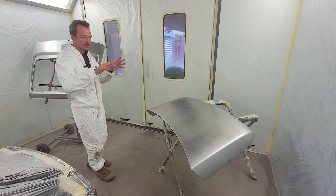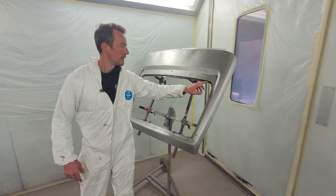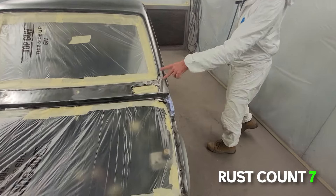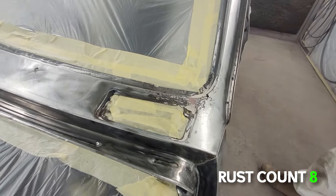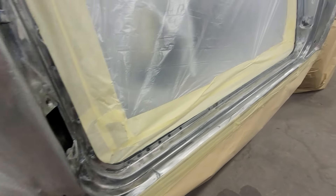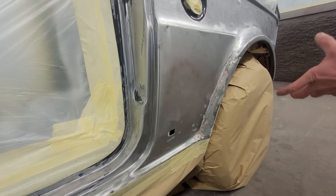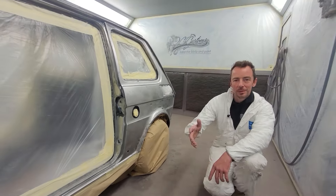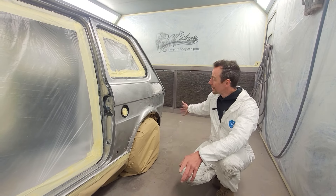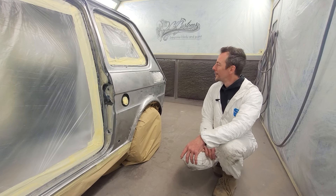We're not talking loads of filler, just a skim to surface it. This side needs a few repairs and a full skin; the other side is pretty much the same — front arch, front of the lower windscreen gone in the same place. The rear arch has been plated up pretty badly and was full of filler. These holes were all filled over because the car used to have big plastic trim pieces and plastic bumpers along the sides, so all those holes were just filled. We're going to be welding up a load of holes, including badge holes on the back to de-badge it and make it look a lot smoother.